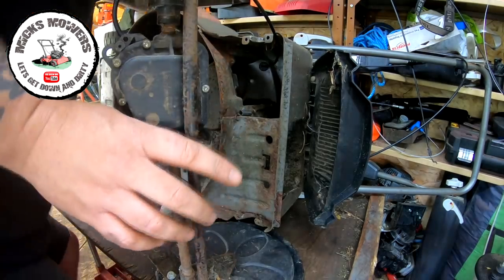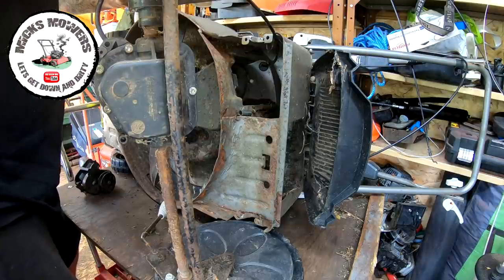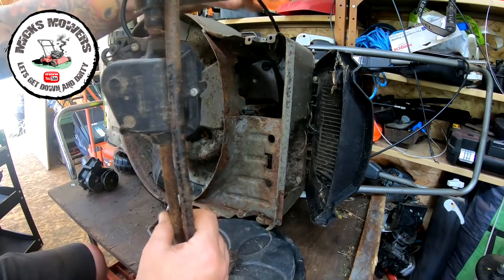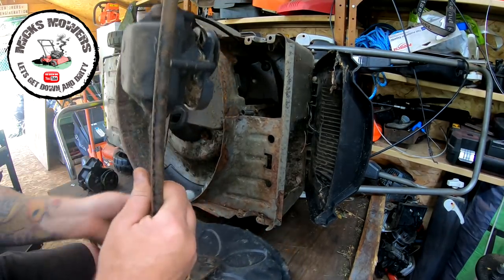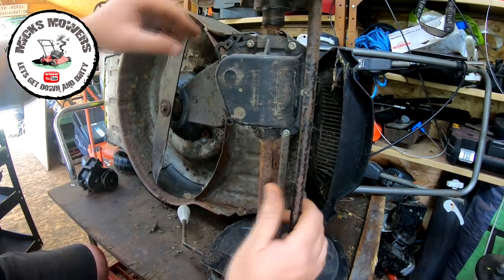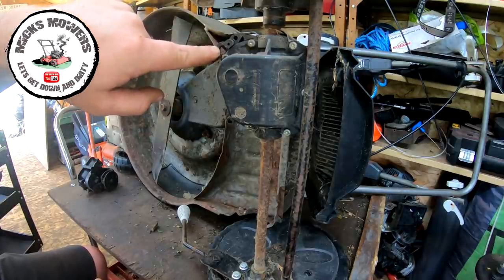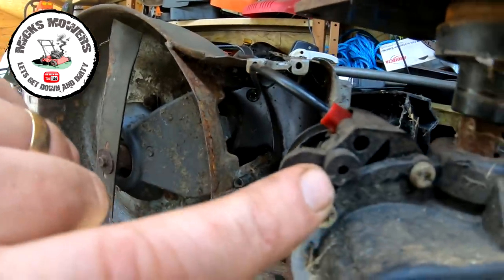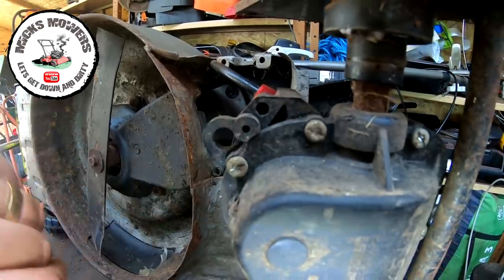If you don't do that first, then you're making life hard for yourself. Let me just get hold of that gear cable. Give it a pull just to get rid of some of that tension. That's it. Good. Otherwise, you're just going to really make life hard for yourselves. So now we can start to fit this gearbox in. And here is the hole. Remember I told you about that spring? The hole sits on this little tiny tab just here. There's a small tab, a small hole. Can you see that? Just there, that spring, you put down with a pair of pliers. I'll show you later on, but it fits in that little tiny hole just there.